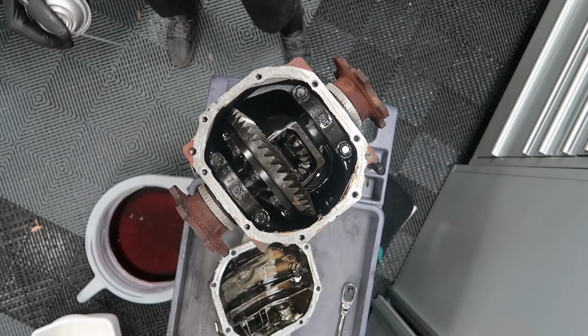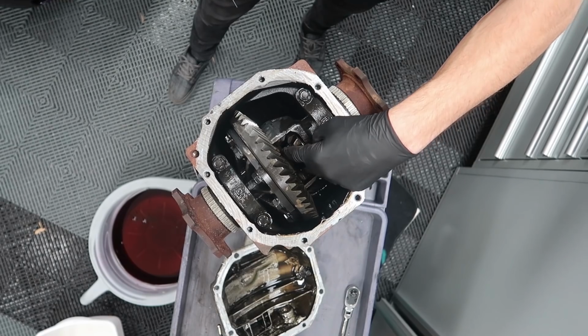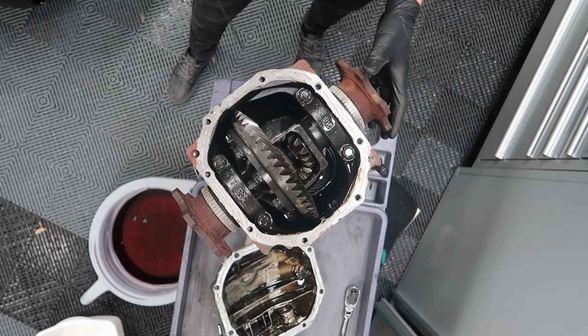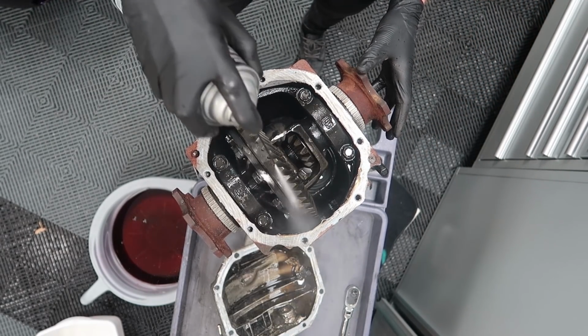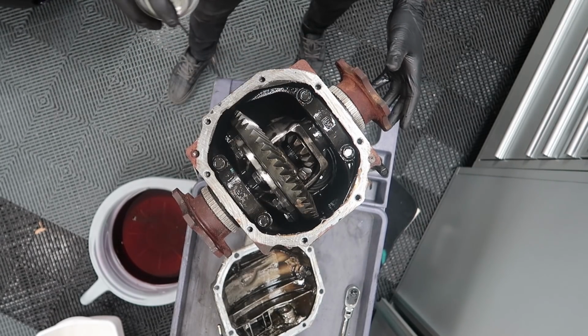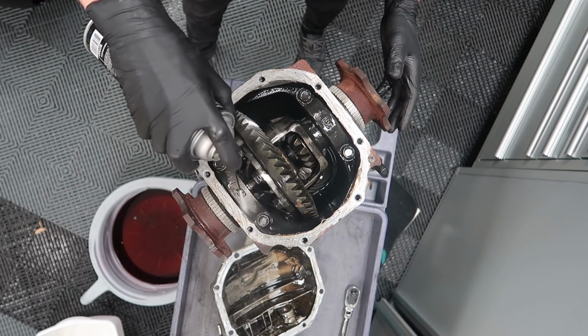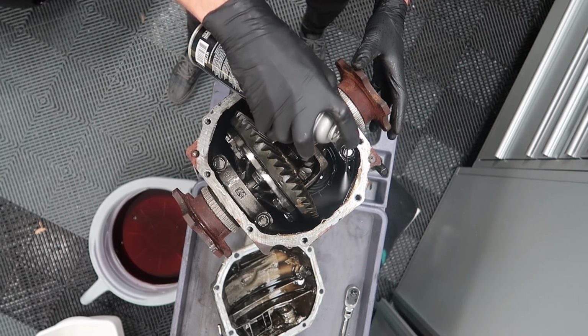We're essentially just gonna brake clean pretty much whatever we can. The important part where they're gonna be welding is in here, but we're just gonna brake clean pretty much everything just to try to get the most clean surface as you can. You can't have contaminants when you're welding. They're probably gonna brake clean more than you did, but it's nice to save their work and maybe save you a little bit of money if you make their life easier.